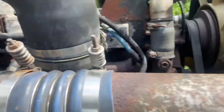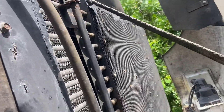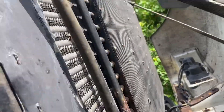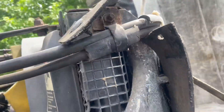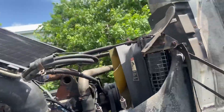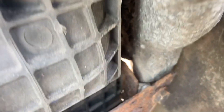So far I'm loosening up all the clamps. I gotta take the condenser off from in front of the intercooler and unbolt that, then I can unbolt the four bolts holding the intercooler on and pull this thing off. I'm going to test it on the ground. Just got the AC resting up there. I'm gonna pull two bolts on each side to unbolt this intercooler. I did find the tab down here on this one is broken off.